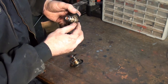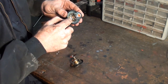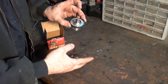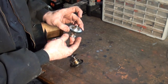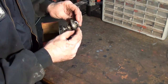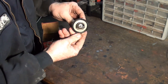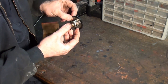As you can see, the new one is completely shut. There's a small bleed hole here to bleed the air out. However, the main port is closed. This one will allow the temperature to build up in the engine, get up to operating temperature at 195, then open and allow the coolant to circulate, continuing that cycle. No matter what I do, I can't get the old thermostat to close, so I'm not sure what happened, but it's definitely stuck open.